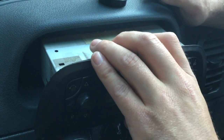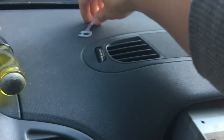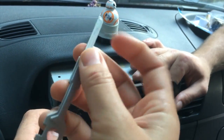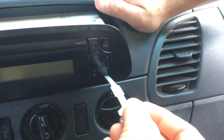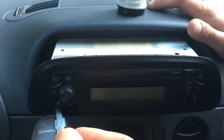The one we got has HD radio, iHeart Radio, satellite — all this stuff. It was only about $120, so it's not that expensive. The stereo itself came with these little hook thingies that you slide into slots. We did this the wrong way — we ripped off the faceplate and then took out the stereo. The correct tools for the Sprinter van are three-pronged with a special clip; you slide them in on both sides and the stereo just pulls out.